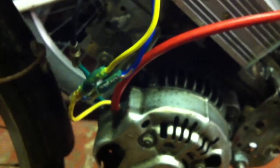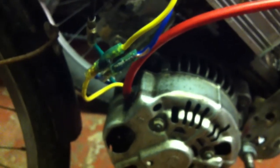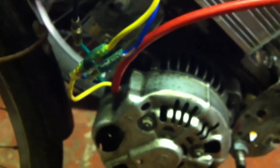So I took this out last night to try it with the highest gearing, just to see if a little bit of throttle assist would help with a normal speed of pedaling. That was with a 32 on the front and a 14 on the back. So I was pedaling away at 18, 20 miles an hour, added a bit of throttle. Okay, no problem. And then it stopped.